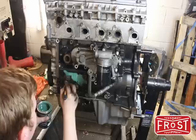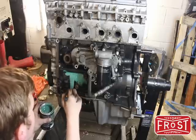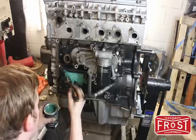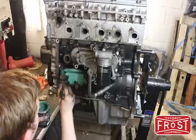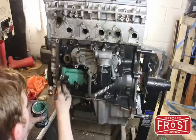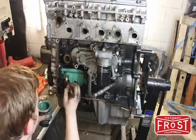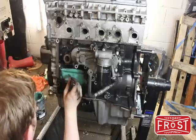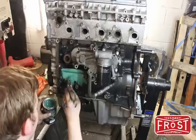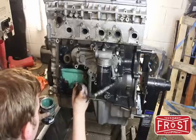I'm putting on a single coat first and I'll let that dry overnight. Then when I come back for my second coat, which can be a little heavier than the first one, I'll leave that again to dry for 24 hours. Finally, the manufacturer of the paint, POR15, recommends that you don't start your engine for six days after your final coat — that's just to give a really good curing time.